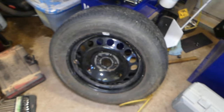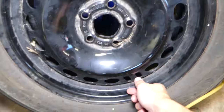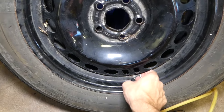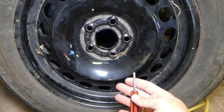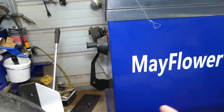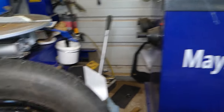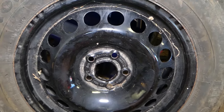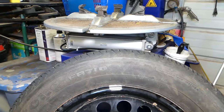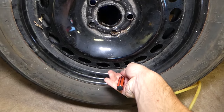To replace the sensor we have to remove the wheel from the car and deflate the tire. All the tools and parts we use will be listed in the description below, including the tire machine and balancer — those are inexpensive but work amazingly well. We had a cheaper set in the past that wasn't good, but this is one of the best you can get for the money. Remove the valve stem cap and let the air out.